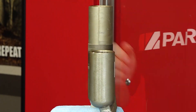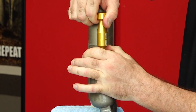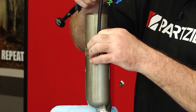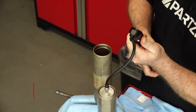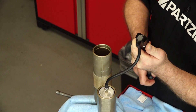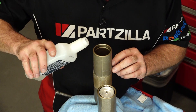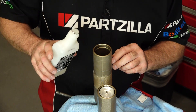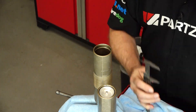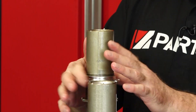Pull it up into position. The good part is there shouldn't be any air anywhere in there with this technique. Now put a little bit of pressure on this — 30 psi. We just want to over-expand the bladder to force it out against the walls; that'll make it more accurate as far as the amount of fluid we're putting in. As long as it's over 25 psi we'll be fine. Now we want to fill up the main shock body until it's about two inches from the top — we're already pretty close. Before we put the assembly back together, it's very important to get the locking rings set for the sag onto the main body, because they will not go on after the fact.